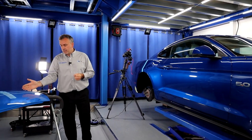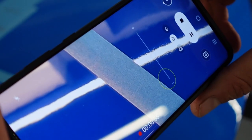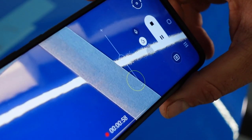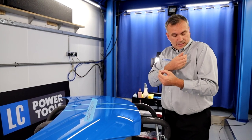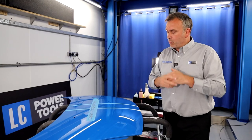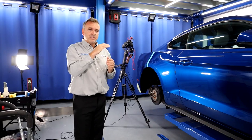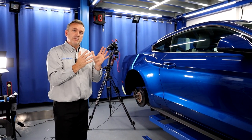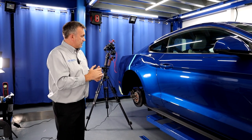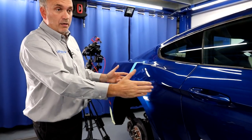It's really easy to see on this panel. We've already polished an area to show you what polishing can do. This phenomenon is literally like — if you have a t-shirt on, it's quite wavy. It's like a waffle, a very fine waffle. And that's the finish you get in new factory paint. It's to do with the drying and the way it all settles as it shrinks and dries. You've got an orange peel finish, and then you've actually got a wave inside the orange peel — so there's a double wave — and it really detracts from the clarity. I can see it very easily on this panel, all the way down.